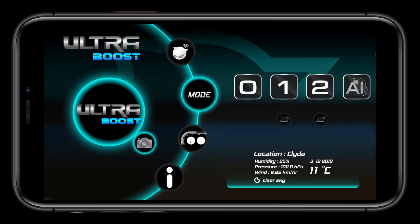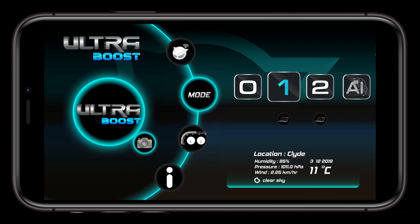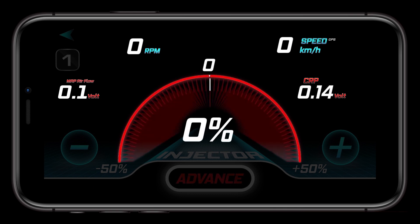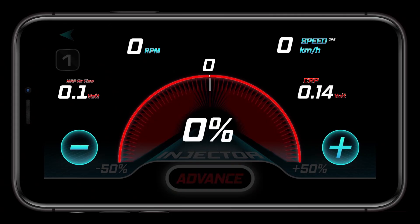Now let's check out how we can edit the maps in each mode. On the right-hand side of the screen, choose the mode map you want to adjust. It is important before adjusting these settings that you have a good knowledge of diesel engine tuning. A laptop icon will appear below the mode you have chosen — tap it to enter the tuning screen. The top left shows your engine RPM and the top right your vehicle speed. Middle left is your boost and middle right is your common rail pressure. The middle of the screen shows the main injector percentage, which can be adjusted by either swiping across the dial indicator or by pressing the plus or minus buttons. Any changes are automatically sent to your UltraBoost unit. On the bottom left of the screen is the set default button to bring you back to the default parameters.